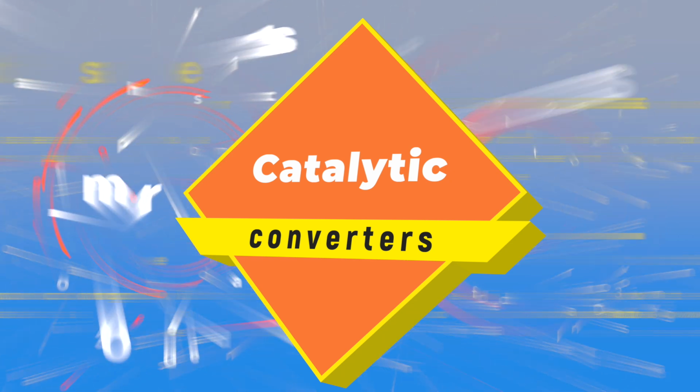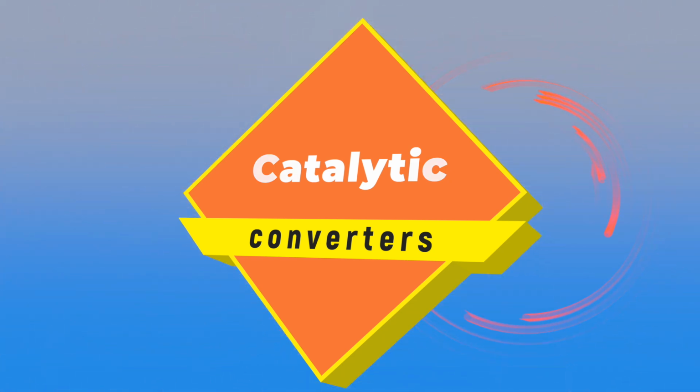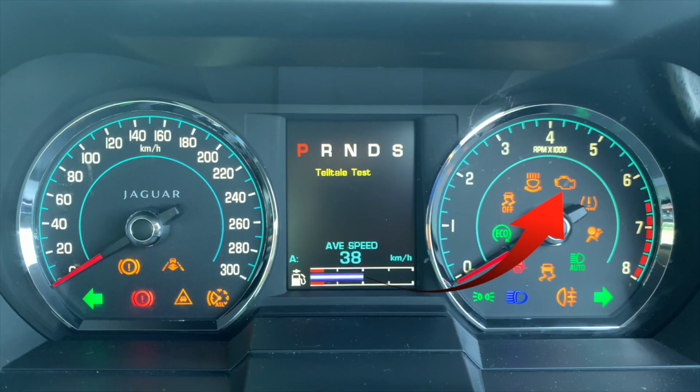Catalytic converters can be an issue on the 4.2 engine, and it'll show up as a check engine light in the dashpod. And there are fuel treatments that profess to clean catalytic converters. I've got no recommendations for these. They may work or they may be snake oil. However, in their favour, there are many well-known brands that offer cleaners, so over to you.